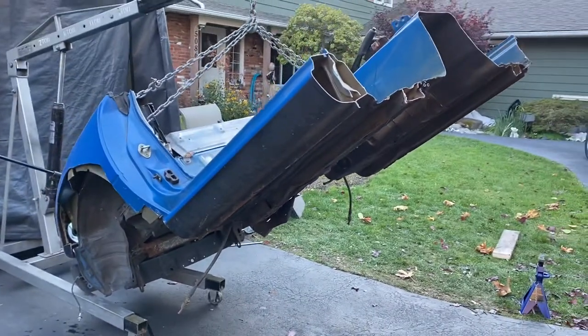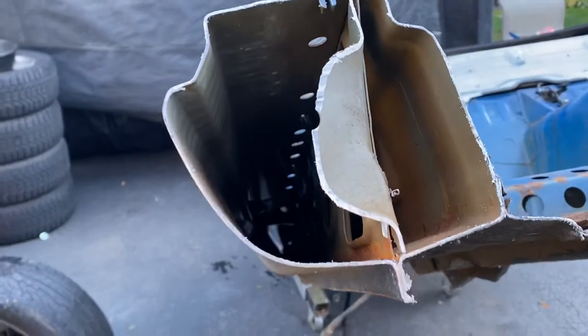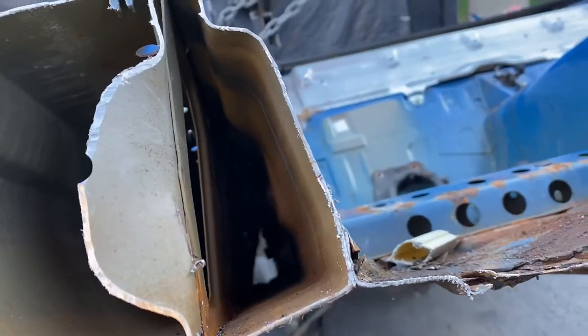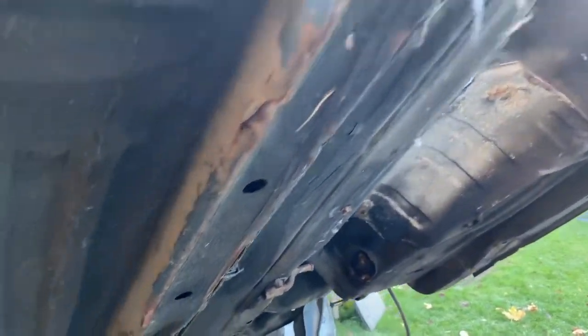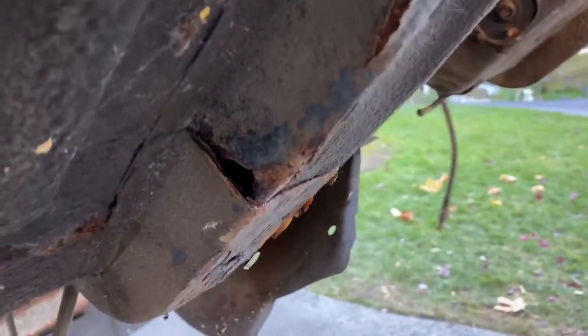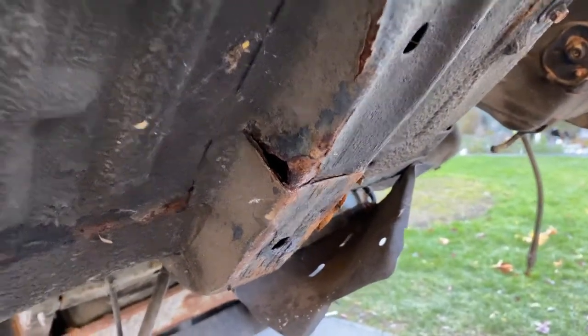There's what's left of the shell. If you want to have a better look and see what's in the rocker panels, that's what they look like inside when you get a nice view right down the sight line of it. And these are the frame rails — these ones are pretty banged up. Usually Miatas will have a couple of dents in them like that, but this one, as you can see, it's rusted right through. So if you're buying a used Miata, take a look underneath and check all this stuff — also check out the pinch welds here as well.